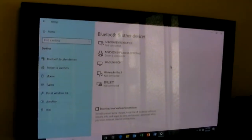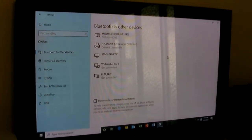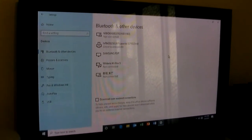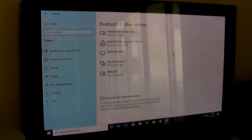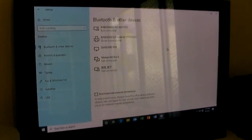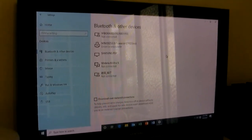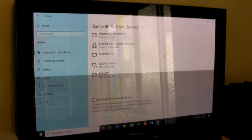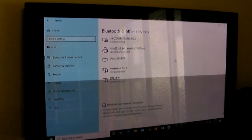So that says to me that this Samsung plasma has a bad connector. Or the other thing it could be is that the HDMI connector on the back has a poor solder connection. Either way, it's looking mechanical. It's not looking electrical. The way to troubleshoot whether or not it's the HDMI connector is to connect the VGA connector to the computer, which you can do quite easily. See, it's just gone to gray now. That would categorically narrow the problem down to the connector, which I may do.